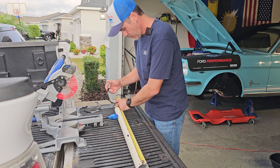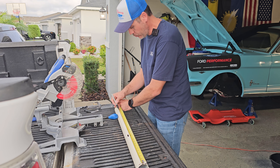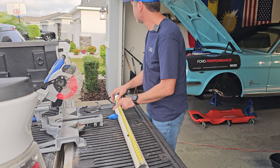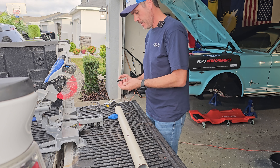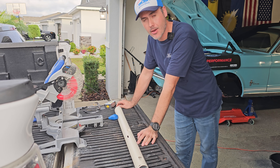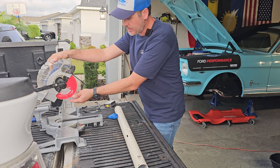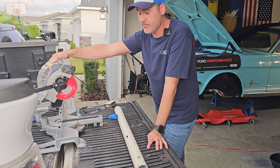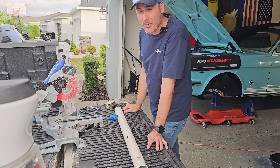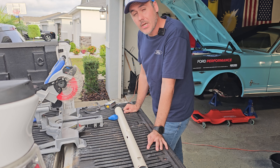So what I'll do is measure from the connector — from the connector to the mark — all the way to the mark, and that gives us 28 and a half inches. I'll be removing about a quarter of an inch from that to compensate for the plate offset and the cap at the bottom, so we'll go with 28 and a quarter inches to cut the pipe.